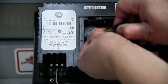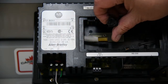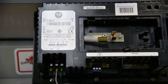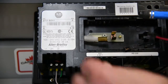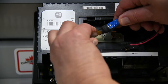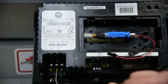Now you take this, and it just slides right off. There's our lens assembly — there's a piece of glass in the middle here, and it's just a plastic holder. Put that off to the side. Take your LED replacement and it slides onto the end. You have to work it in there, and you get it down as far as it will go, and then that clips right in there.